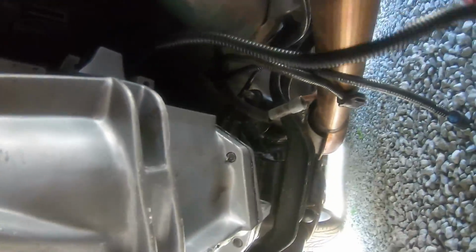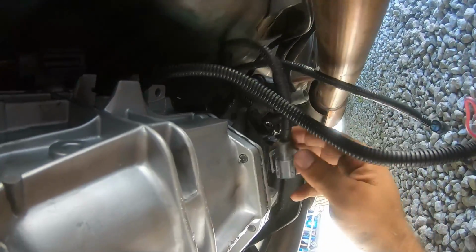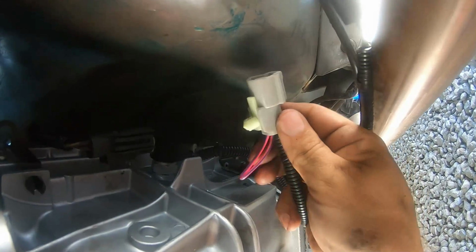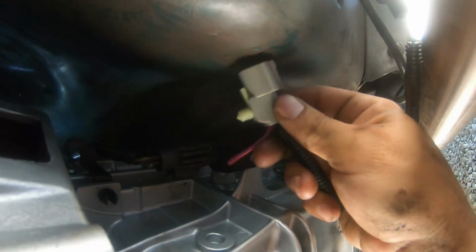We're ready to go. Okay, we went ahead and jack stand the car up. We're at the point, we're at the transmission. I'll show you some of these harness pieces that we just, this is the VSS, goes in one way. Boom, all cleaned in. This is your neutral safety. And remember, this is that reverse light switch. If you didn't have this loop, you wouldn't be able to start your car.